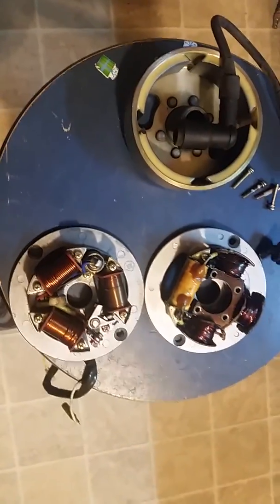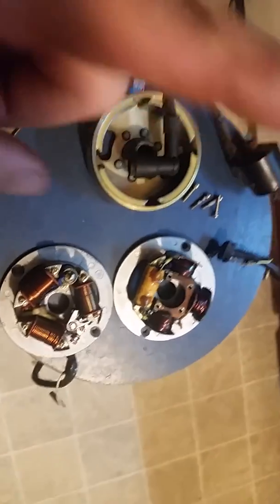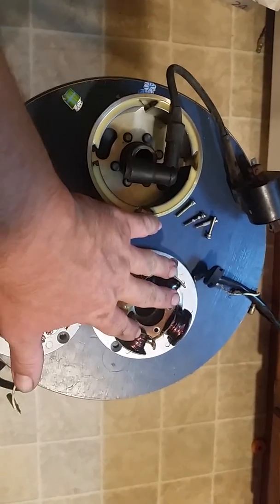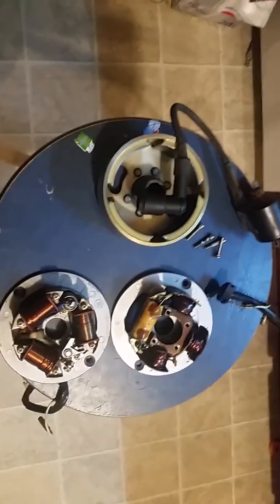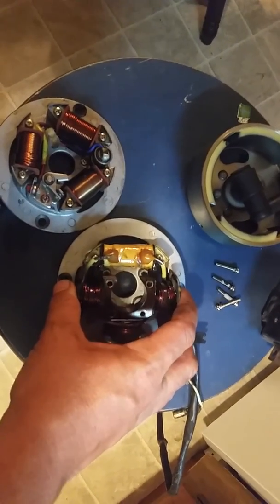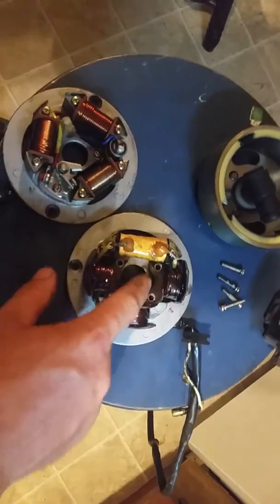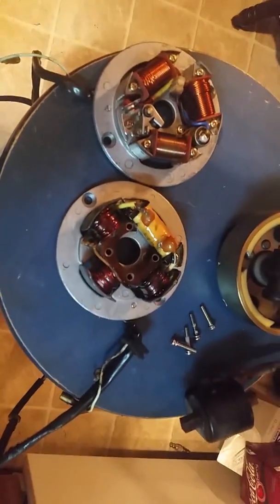Here's the part you're gonna love. David — this one's for you, on the Kawasaki forum — you wanted a 12-volt coil for your bike with electronic ignition because you have a newer bike. I have the solution. Tonight I pulled the CDI ignition off a parts bike and discovered something: they are two separate coils. These three right here are your 6-volt charging coils — you undo four screws and that section comes right off. And here's where Kawasaki did us a solid.